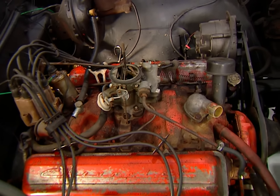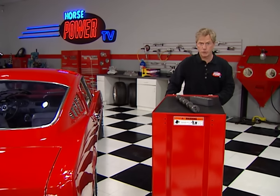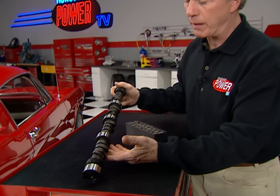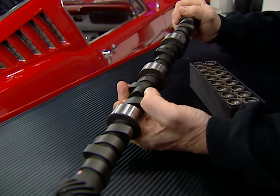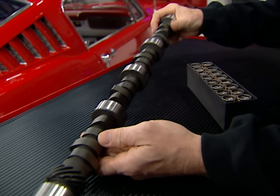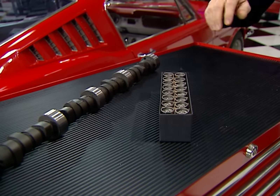So I've already started the job by disconnecting the battery and draining the radiator. While Chuck's hard at it over there, let's check out what we're upgrading to. Our cam is a 265 dual-energy grind we got from Comp Cams. It's called that because the exhaust event has more lift and duration than the intake. This compensates for things like inefficient port design or restrictive stock exhaust manifolds. Any time you get a new cam in, you need to install new lifters as well, like these that came with our kit.